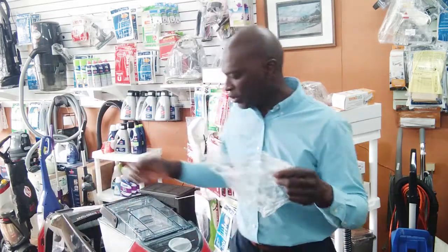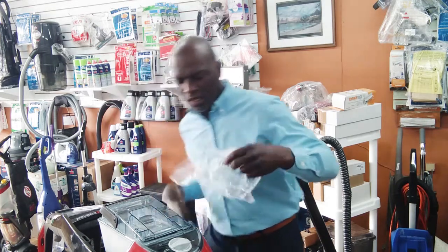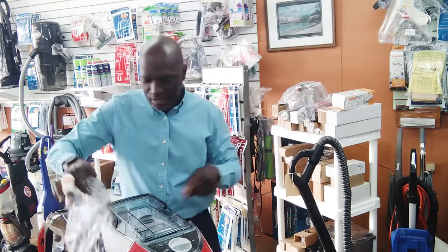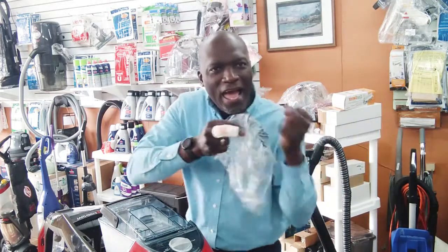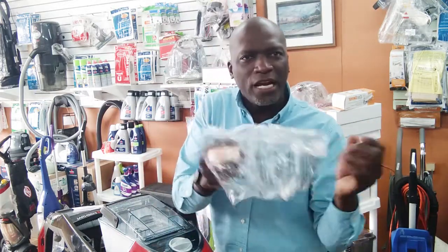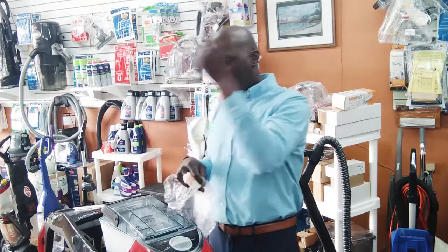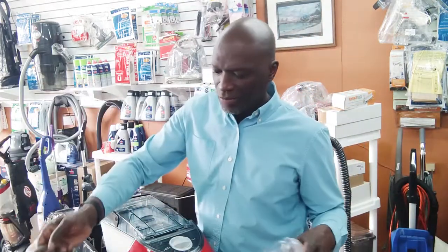This is the test. You turn on the unit, you can see it all around, and see if it's trying to pull at the loose paper, the little rice paper or whatever, or this plastic. See if it's trying to suck it in. If it's trying to suck it in, bam, we found our problem. Okay? Same thing with all these same units.